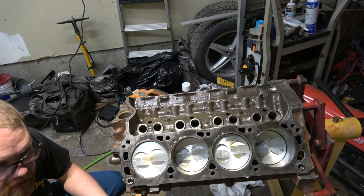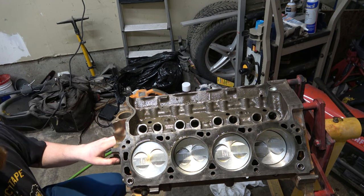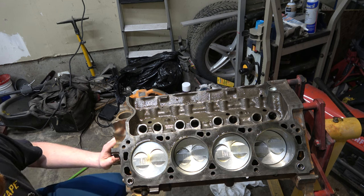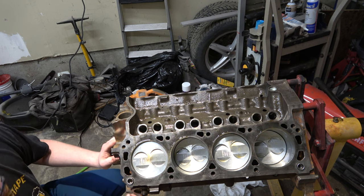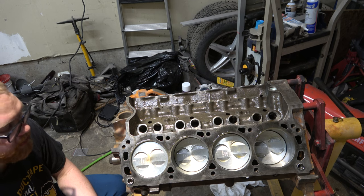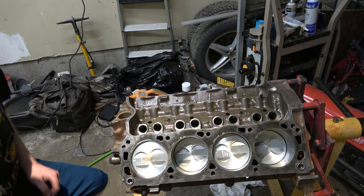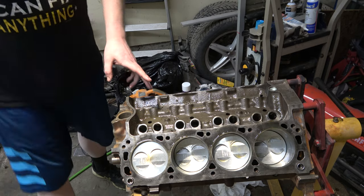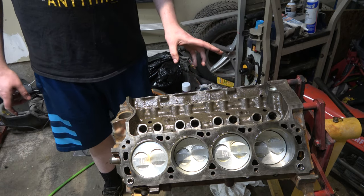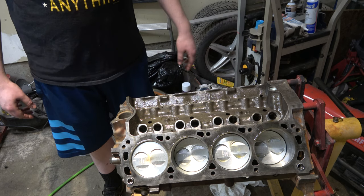I have a huge order of some racing parts — we're going to put in our camshaft and new lifters, get the oil pan cleaned up and painted, new oil pump and pickup tube cleaned of course, get that oil pan on. I've got a one-piece oil pan gasket on the way — Fel-Pro, same as the valve cover gaskets. We'll be able to get this thing mostly put together. The only thing I don't know — I'm probably going to have to get new push rods and may need new rocker assemblies, so that's not going to stop us from getting the engine back in the truck and running it.